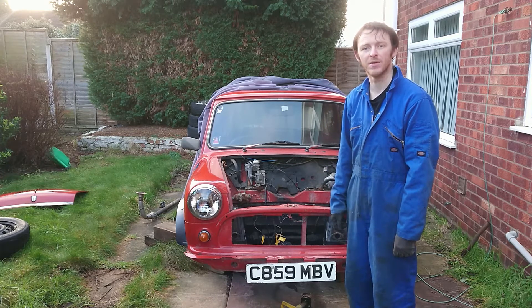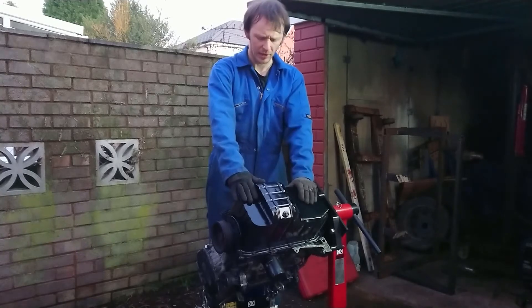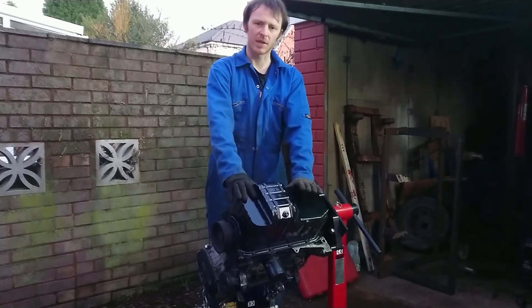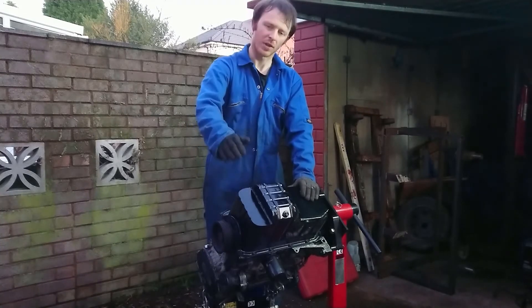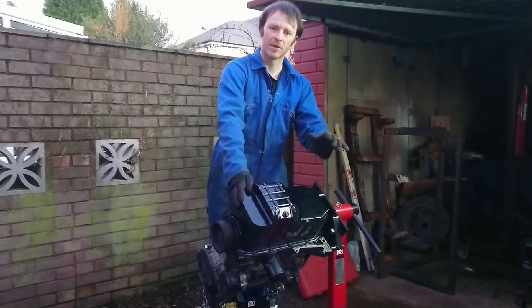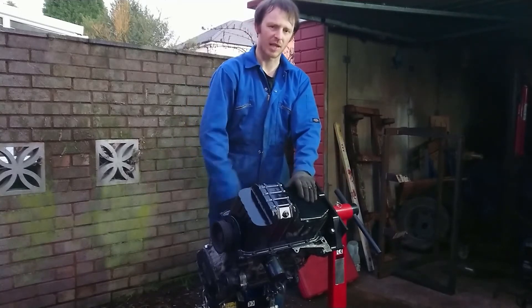This is the mini's engine. It's a CG10DE from a K11 Nissan Micra. I believe it's used in a few other cars as well but this one's from the Micra. To get it ready to go into the car there are a few things we need to do. Because of the subframe design, the sump has had to be slightly modified — that required a notch to be taken out to miss one of the lower bars. Due to the capacity lost there, a section was added which brings the bottom of the sump down by about 20mm to get the capacity back. This has lost about 400ml but gained about 600ml — a bit more capacity, which is always good and keeps engine temperatures down over the service life.